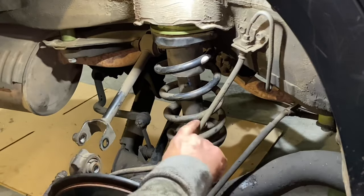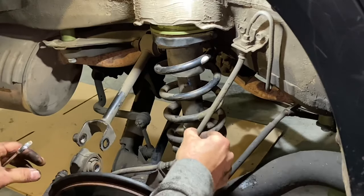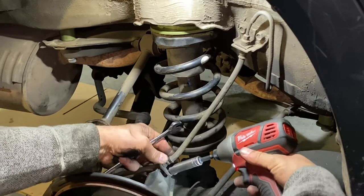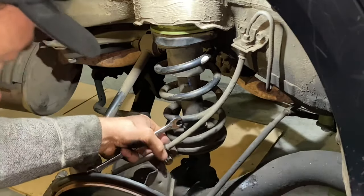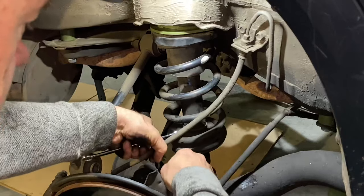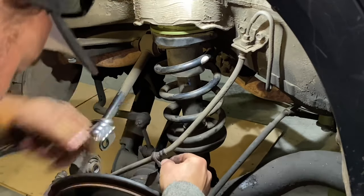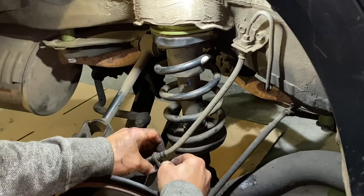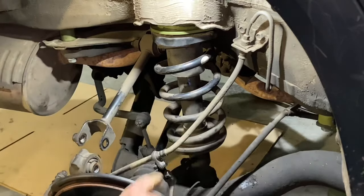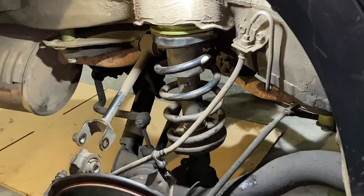Notice this brake line is a little bit taut — we're not fully bolted together yet. Once this is bolted together it's not going to be that tight. We do have a solution for the brake line in the kit: these little one-inch brackets. This is just a little one-inch bracket that brings it up just enough that it makes a difference in the tension of the brake line. You'll see it still looks a little bit tight even with the brake line bracket in place, but once this is all in place it has more slack.